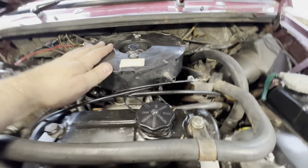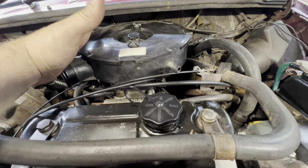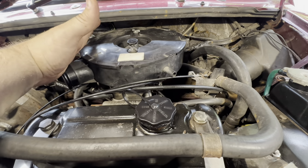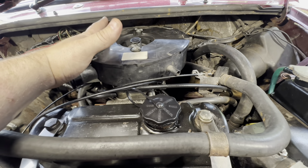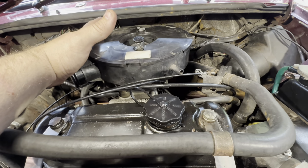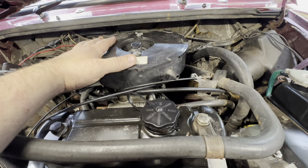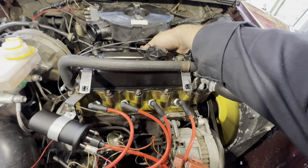Moving our attention to the carburetor, this is where our flat spot was. So our oil was too thin. So for some reason, although it has been told to me this has been tuned by me before, I don't think so, because this is 1.2 on acceleration. So the needle was one of mine, but somebody's played with it since and they fitted thinner oil in the carb. So I changed it to 2050. Didn't need to do any mods because I'd already done the needle and she runs absolutely fine. So let's let the owner go in it and see what they think.